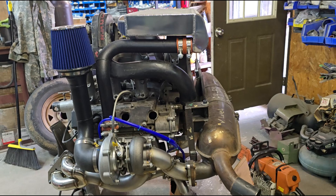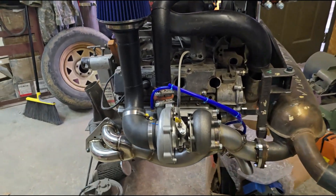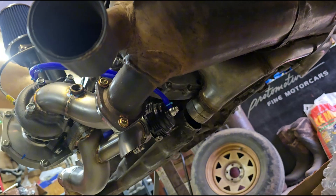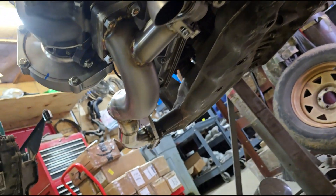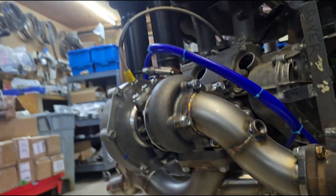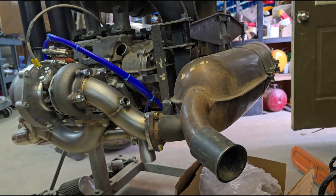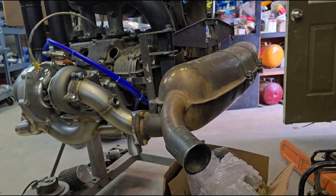You can see it's a relatively simple configuration — kind of half of a twin turbo — but we're using the factory heat exchangers. Factory heater boxes going into the J-tube, which plumbs out to a wastegate, comes into the turbocharger, and plumbs right back into the stock exhaust system, or whatever kind of aftermarket performance exhaust system we can provide mufflers for.